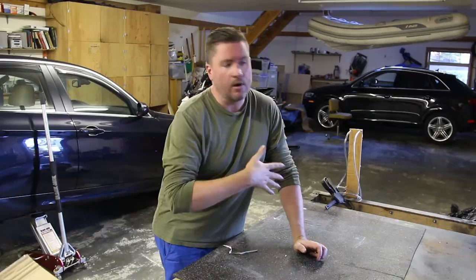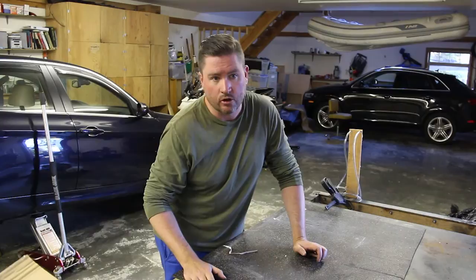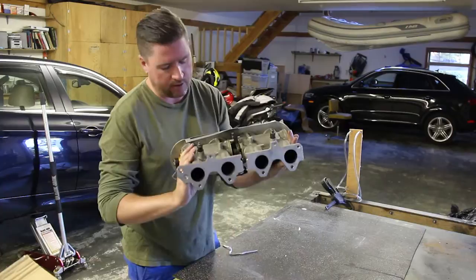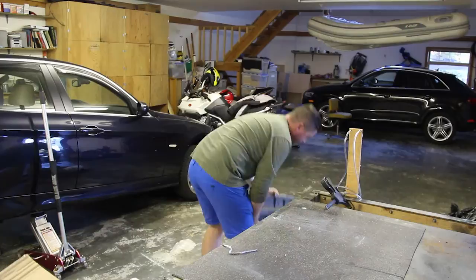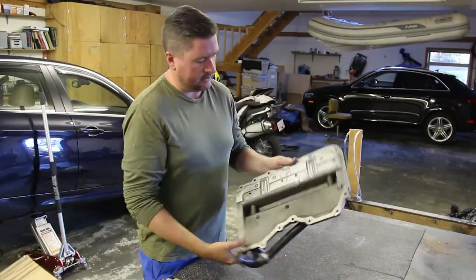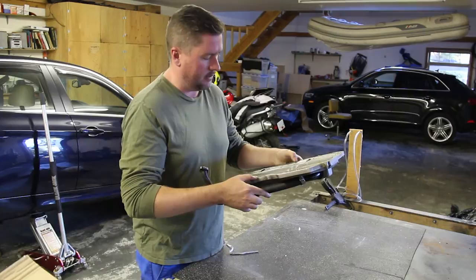So the box from England — I have a box full of parts from a Cosworth CSR Caterham motor. It was actually a 260 horsepower Duratec. First off, a pair of used but in pretty good shape Caterham-branded roller barrel individual throttle bodies, with individual injectors on them. Number two, a dry sump system — I have a Pace dry sump pan. You can actually see what happened to the old motor: there's a bit of what looks like rod bearing gouging at the bottom of the pan.